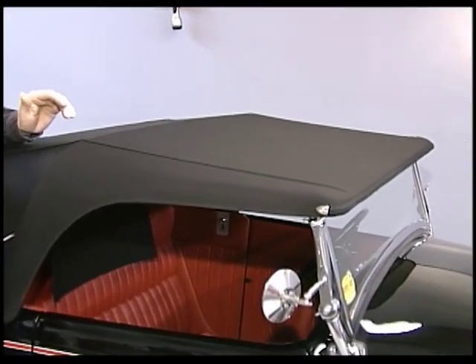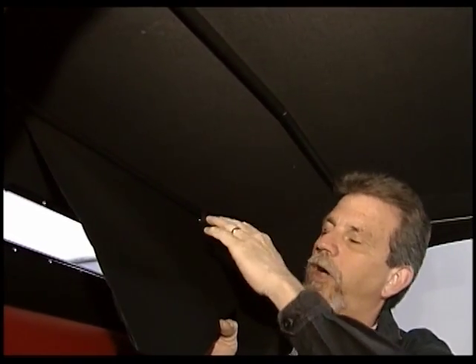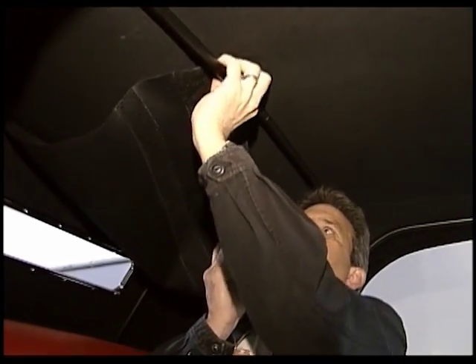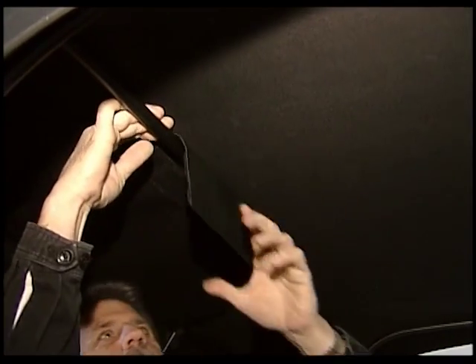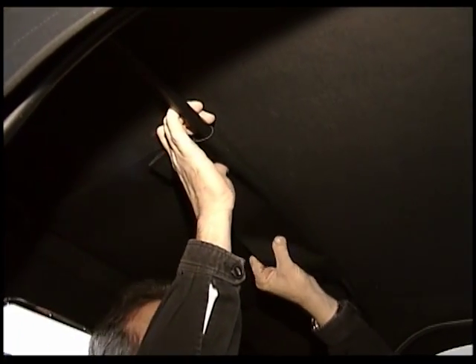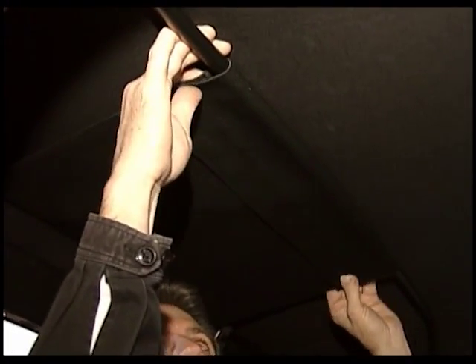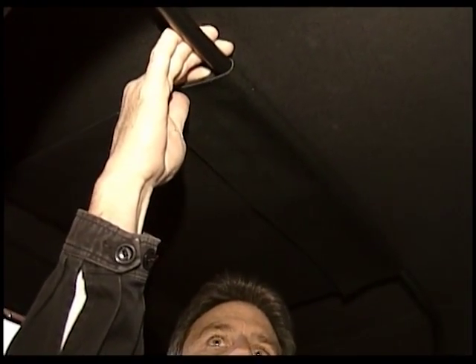Let's finish the curtain and we're done. Now we're going to finish up this curtain and show you how to remove it and install the little piece that hides the bar in the back. This flap that we pushed through first goes up and over the center bow and velcros back. What this does is keep tension on the top when the rear curtain is removed. Feed it through, pull it over the bow, pull it around and velcro it to itself. Put a good little tension on it — the velcro should line up. Cinch that down and it keeps tension on the top when the rear curtain is removed.